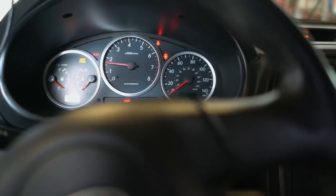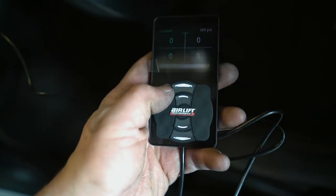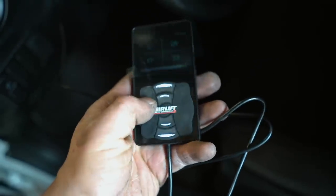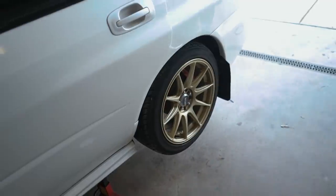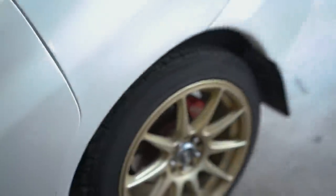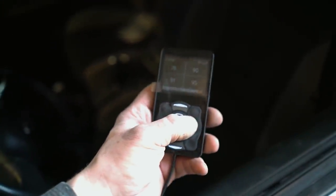Wheels are on the car. First off we have to put air in each bag. Let's try that right now — see if we can get the bags to air up properly; you can do each bag separately. As you can see, we have quite a bit of air in each bag separately. It already looks like it's gonna be pretty low, because this is aired all the way up and we don't really have all that much gap, so I have to do quite a bit of adjusting on the struts. We got it off the stands — this is the aired-all-the-way-up height and honestly it's like 100% stock. You can't even tell I bagged it, but I have yet to go lower on this thing, so I'm going to go corner by corner.